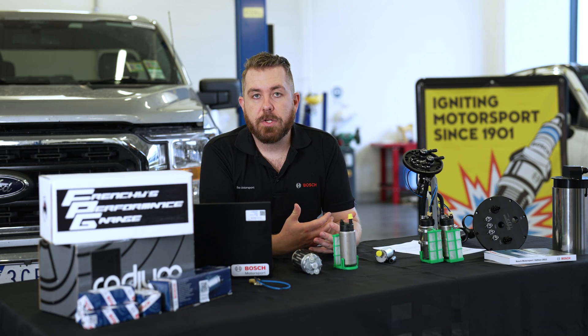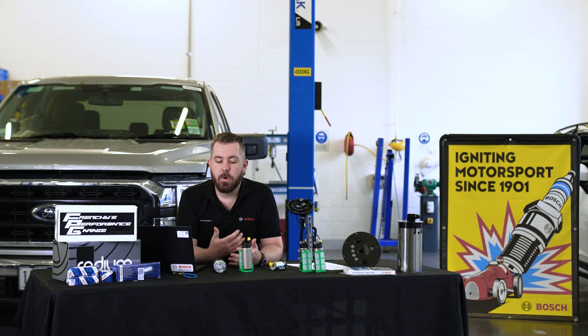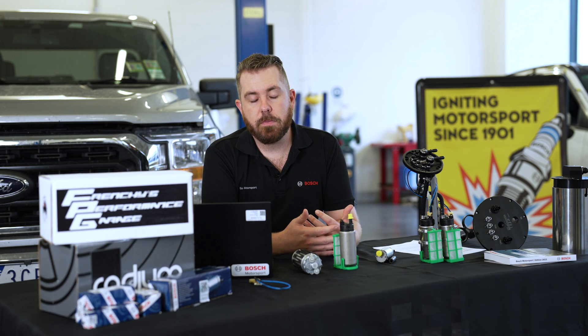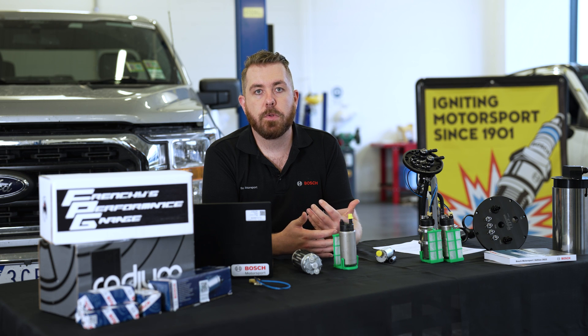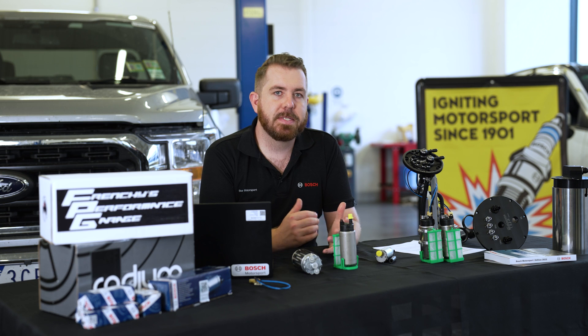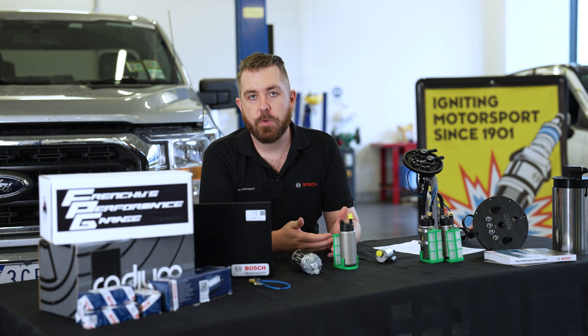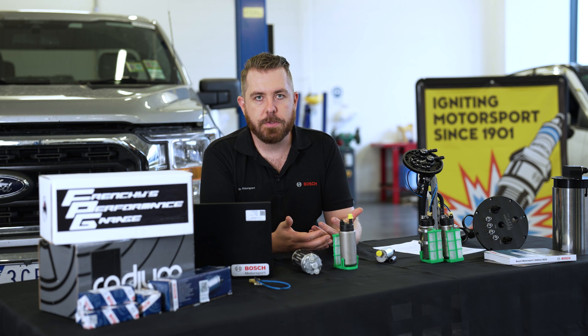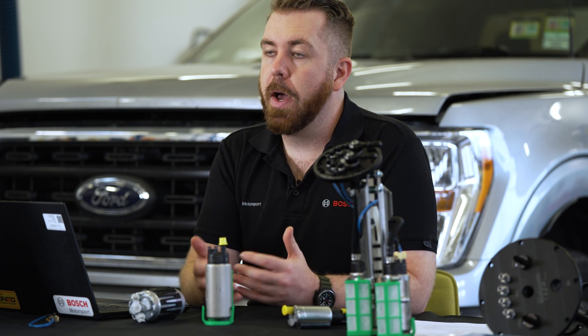The second issue is fuel over pressure. In a system without the correct amount of pressure regulation, you can see pressure increase above the designed amount, which can lead to excessive fuel being injected through the fuel rail and could actually create a dangerous situation where your fuel lines are over pressured, leading to failure of fuel lines, fittings, and so on with a burst. Here at Bosch Motorsport we say the optimal fuel pump is sized around 10% above the maximum fuel requirements for your application. We call this the safety margin — it ensures you're not oversizing your pump while still allowing wiggle room for situations where more fuel might be required than on the dyno.